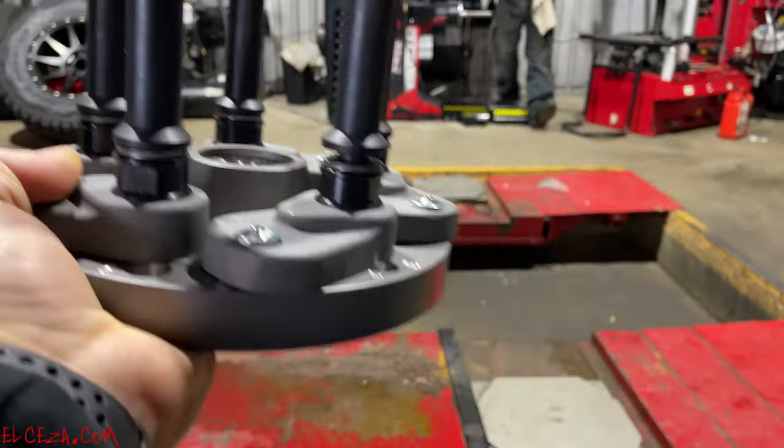Now, you're going to know when that happens. You can hear that butterfly spinning off the end. If any of you ever had it happen to you, you know exactly what I'm talking about. You can hear the butterfly rattle on the end of that. And we're going to reach over here and step on the spindle stop. I'm going to stomp on it.